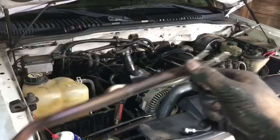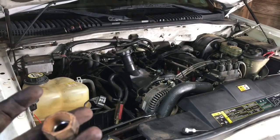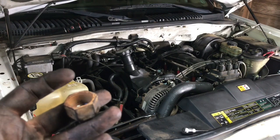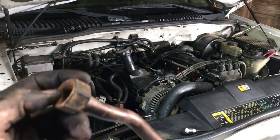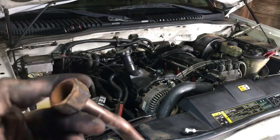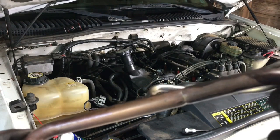I just came across something — it'll come off and be out of our way. Now it's off. These can be kind of hard to get off, especially on the exhaust manifold side — just be careful not to break anything. When putting this back on, I highly suggest putting some anti-seize on the threads so it keeps it from seizing up if you ever have to take it off again.